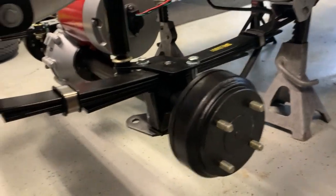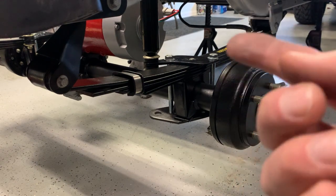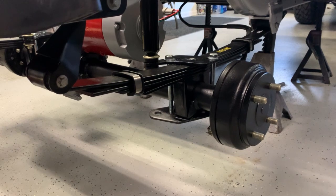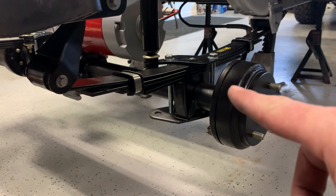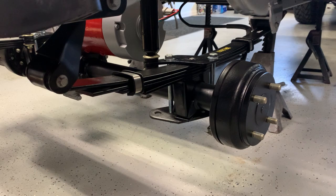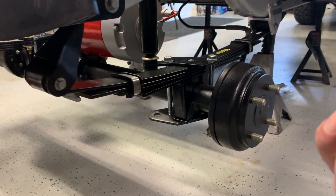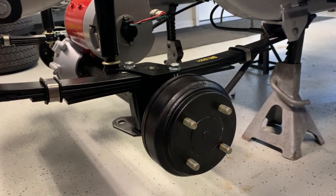All right, so that wraps up our rear end. I did struggle a little bit getting that aligned because I had the other side tightened down already — just work it back and forth a little bit. Make sure those pins are in where they need to be; you shouldn't see any light coming through any of those mount points where the axle goes through. I always go back through and make sure they're hand tight rather than just hammering with an impact gun. Go back through, check your nuts and bolts — and that's really it on the rear end.